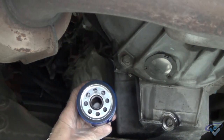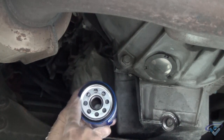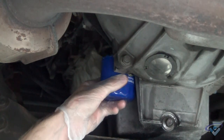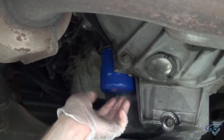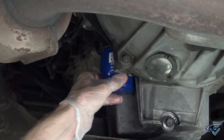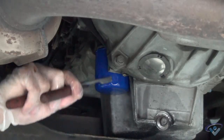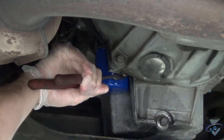Once that's out of the way, find your new oil filter and apply a dab of oil around its ring. Make sure there's only one oil filter gasket you're putting on. If you have two, you're going to run into a huge leaking problem, so be sure there's only one. Because this is an awkward location for a vehicle, first snug it up with your fingers, and then it's okay to move on to an oil filter wrench to further snug it up. However, you don't want to torque it too hard, for you don't want to strip anything. Snugging is just fine.